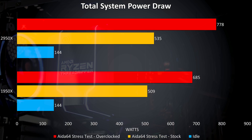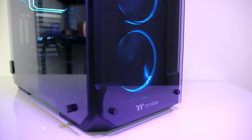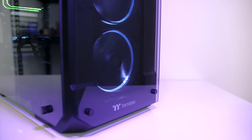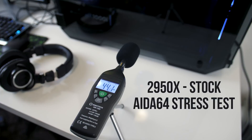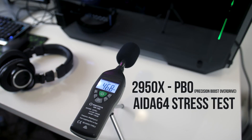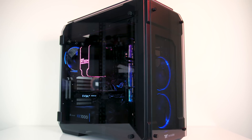I'm going to look at replacing the measuring tool in the future. The 2950X overclock listed is maxed out at 4.15GHz while the 1950X overclock is at 4GHz, which is why the overclocked power differences in the red bars are further apart. The total system noise levels include the case fans too — rather than showing a graph I'll let you listen for yourself. In general, overall system volume levels were about the same regardless of CPU, at least with this cooler — just extremely minor differences if any at all.